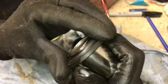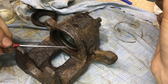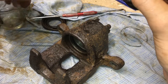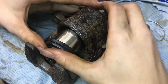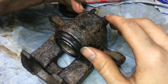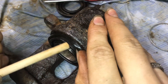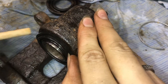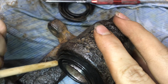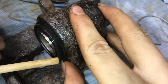This edge right here on the rubber boot is going to slide in and around on the caliper, so we're going to push this in now. It definitely slides a lot easier — I can just feel it slide right into place. With a wooden stick or your fingernails you can slowly push this boot into place on the caliper. You definitely do not want to use metal, and just slowly work it around — you do not want to puncture the rubber boot in any way.